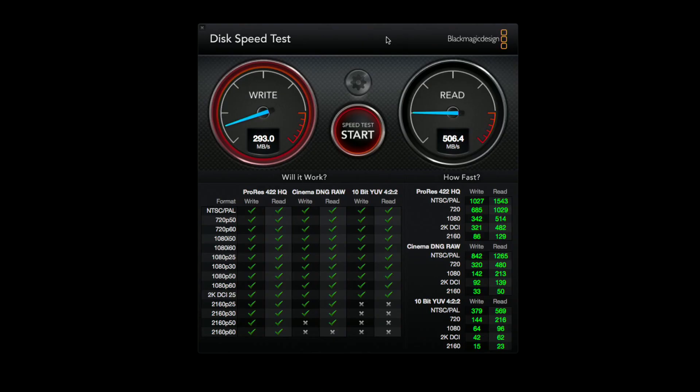So let's take a look at how the drive performs. I've got it plugged into my brand new MacBook Pro here. My write speeds are typically around 300 megabytes per second or so on the Blackmagic disk speed test — this is a sequential test that mirrors copying files directly to the disk. You can see it go very high up into the 400s, and then it drops down into the mid-threes. What's happening is they have a cache on board that fills up, and then you'll see the writes quickly drop down as that cache fills yet the data keeps flowing in. So it is very quick, but it's no faster than last year's drive and perhaps a little slower on the writes.